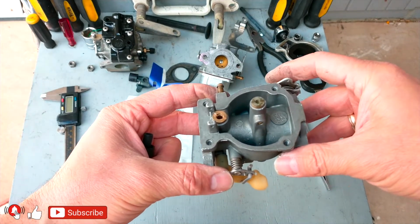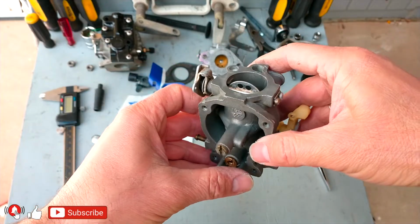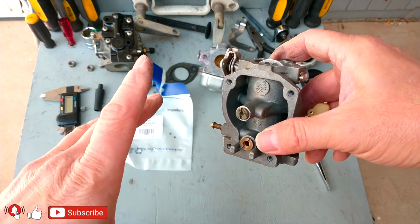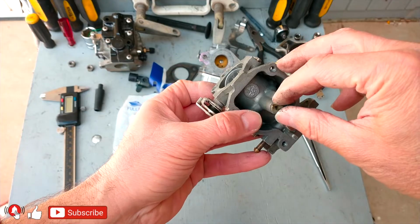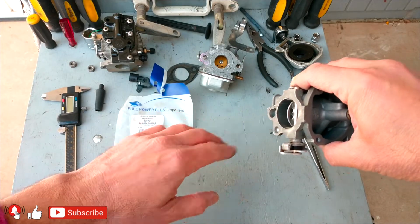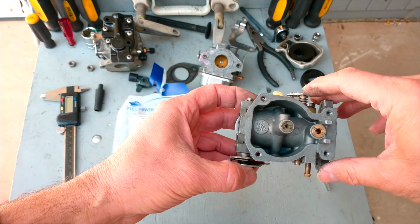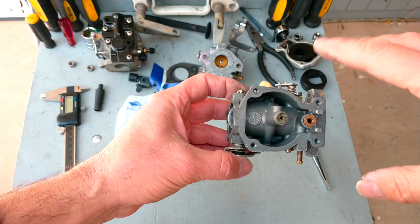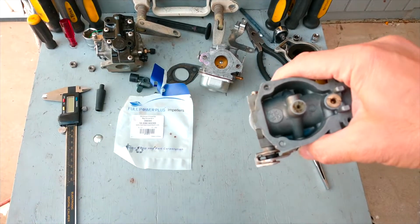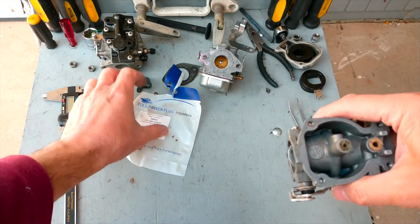It's very interesting. Looks like someone had a problem with this carburetor. They came to me with a disassembled engine and I suspected there was something wrong with the carburetor. So when I cleaned it today and started blowing from here, those pieces started coming out from this side. They just show up here and they fall off. So make sure when you clean the carburetor, when you blow with the compressor, go from this side. Of course the jet is supposed to be here, right now it's in position. Find that video, watch it and go from this side first, and this is what comes out.